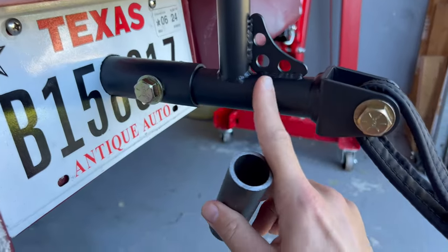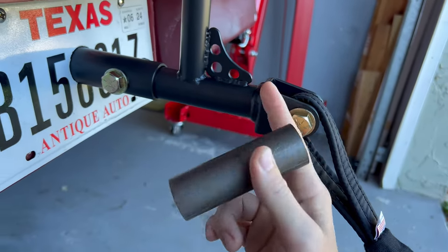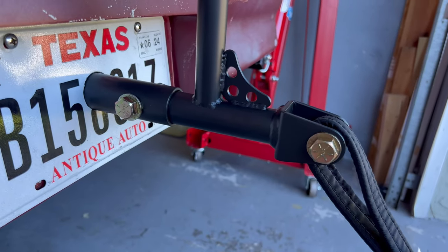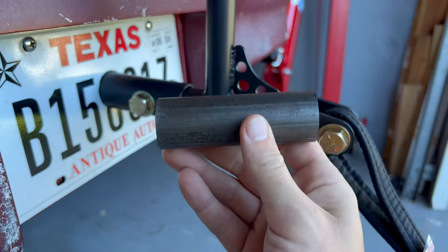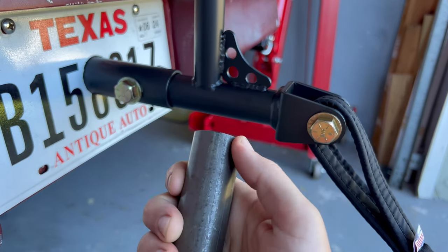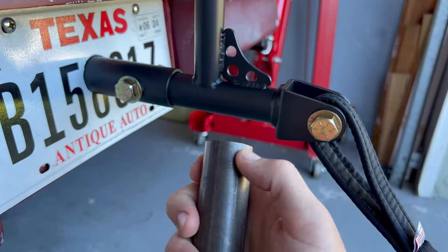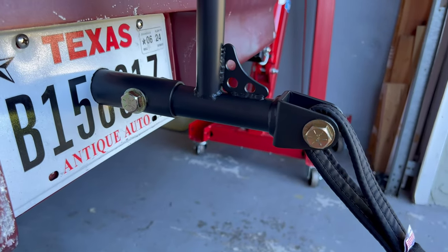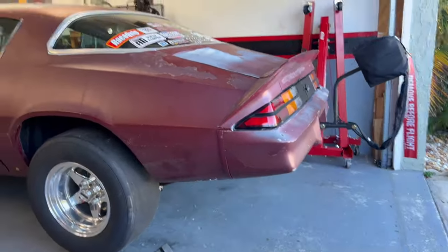For a trailer hitch idea: since that receiver bracket is inch-and-a-quarter — the excess I cut off — I'm going to get another piece and make it long enough to bottom out in the receiver. Then I'll find a small trailer hitch receiver, put this tube inside it, cut the receiver corners, bend it down to the tube, and weld the hell out of it, then drill our hole. That gives us a nice trailer hitch receiver combo. Not too worried about that right now though — I'd rather get the car on the ground first since we're pretty much right at the bottom of the bumper anyway.